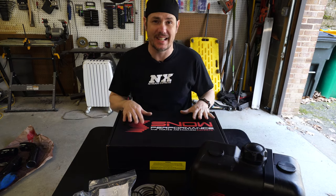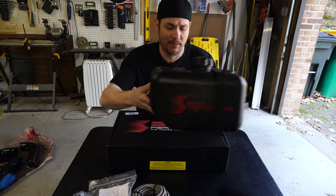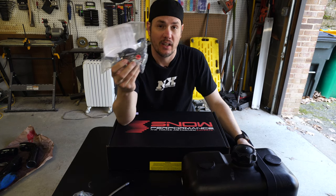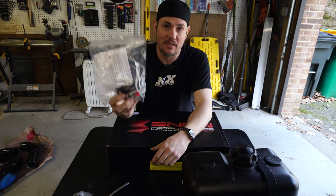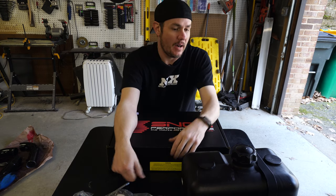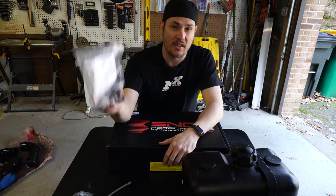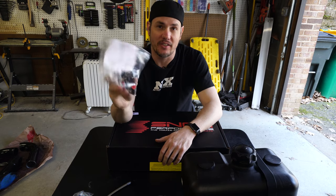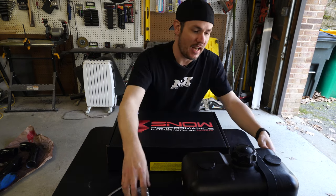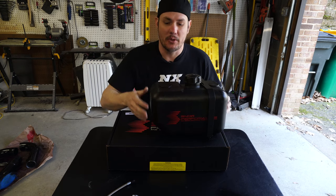We've got a couple of parts to talk about before we get into the unboxing of the kit itself. One is we're going to be running the two-and-a-half gallon cell — we'll mount this in the truck and run the lines up front. We've got the nice stainless steel upgraded line kit. And because we are running this in the truck, we are running the solenoid upgrade. Basically it allows you to shut off the line by the pump to keep vacuum from pulling your methanol water mix, which can create a siphon effect in some situations. So it's always a good idea, especially if you're running a lot of hose, to go ahead and do the solenoid upgrade kit. Then we will do an outlet and go through the mounting portion, running all the lines up to where we mount the pump.